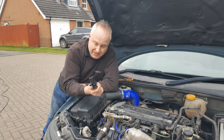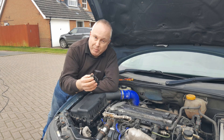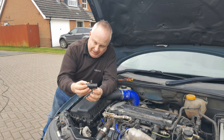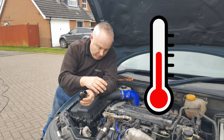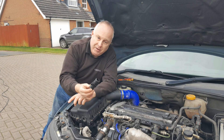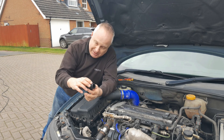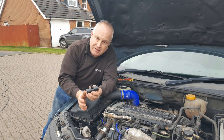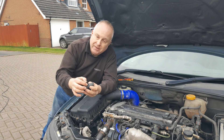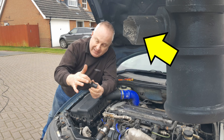Now that's a very good material to make this from - it has good thermal stability, very strong, good creep properties as well, which is great considering it's been clamped for its lifetime. But like an awful lot of plastics, with the heat it experiences in the cooling system which is ordinarily up around the 90 degree C mark, potentially higher than that on occasions, the plastic does degrade and the polymer chains break down and that causes the plastic to crack.